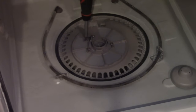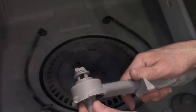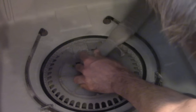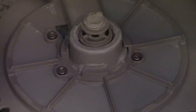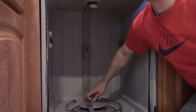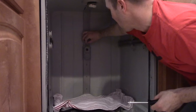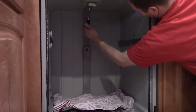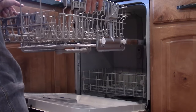Hopefully cleaning and clearing it out fixed your problem. Before you put the plug back in, slip on the clear ring, put it in the arm, and insert the arm. Give it a 45-degree turn and it should lock in place. Then put on your lower sprayer arm — the nut inside that you tighten it to should be able to spin freely; if it doesn't, you need to pull it up and loosen it. Then put in the back screw and the top screw, and always use a cloth to catch the screws in case you drop one. Slide the racks back in and throw the clips in place.